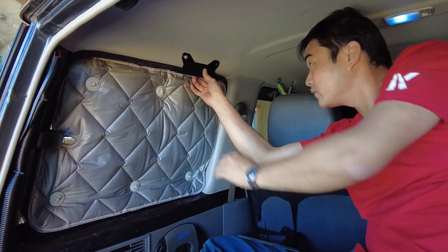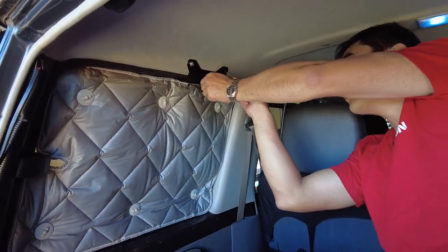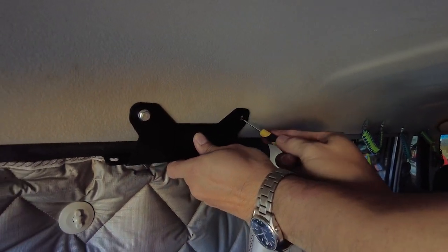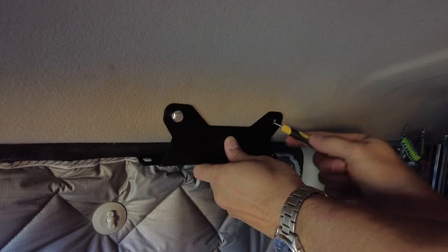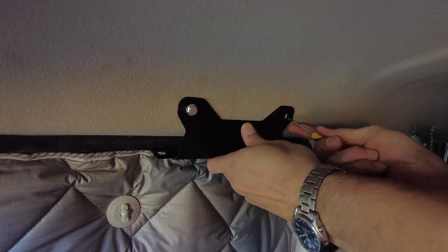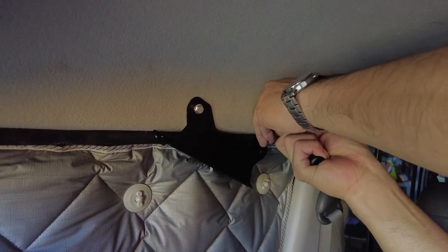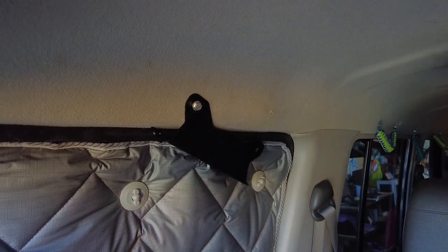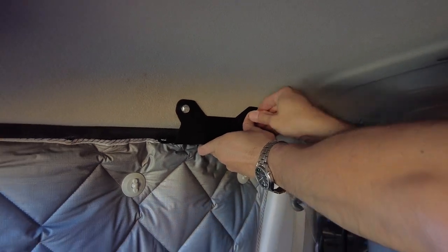Just finger tight. Now I'm just going to level out that bracket. I'm going to grab a little screwdriver so I can poke the hole through the lining. Now you're going to have to trust us that we've got this right. Push it through — there you go, found that hole. You just want to open up that hole in the roof lining a little. I'm just going to push that roof lining back a little. That should be enough to get an M6 bolt through — it's snug but it'll get through.